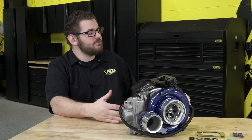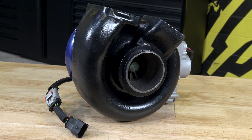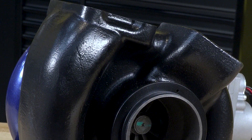So what makes the turbo different from a stock unit to get more power? To get more power and reliability out of these turbochargers, we first started with the exhaust side. While other manufacturers are going to machine out the factory housings and throw larger wheels in there, we completely redesigned the turbocharger. We cast it all out of HSM. HSM is a little bit more expensive in the casting process, but it handles heat so much better — and that's really what we want in a turbocharger, to handle those EGTs that keeps your vane pack alive and keeps the unison ring from warping.